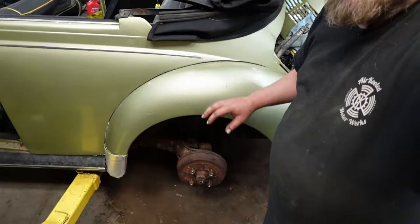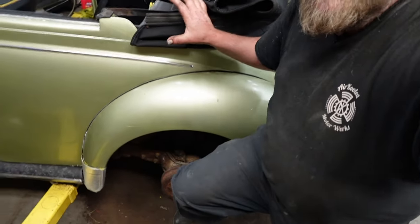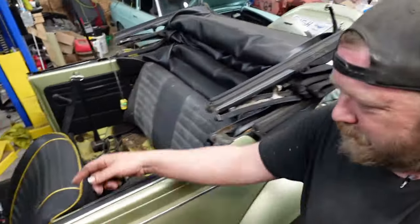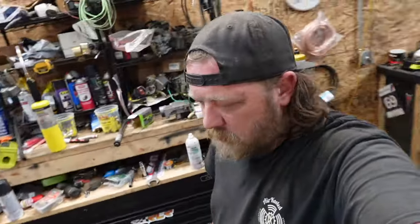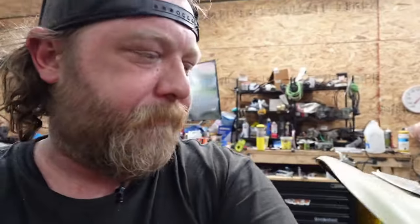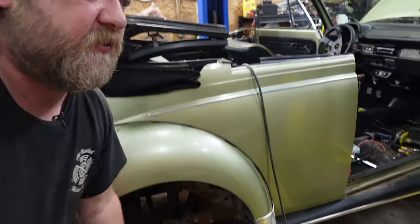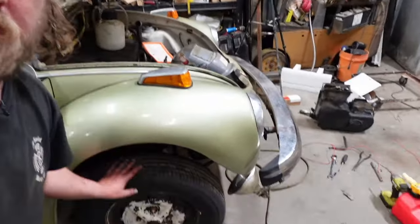I was watching this wheel for rotation, because usually the driver's side spins. Well, the problem being right now is, yeah, it's plumb locked. E-brake's not on. They're pretty much all like that. I was able to back off the adjusters on this side, and it's still super tight. Fronts are rolling, but questionable.